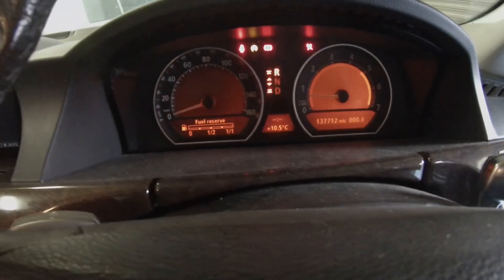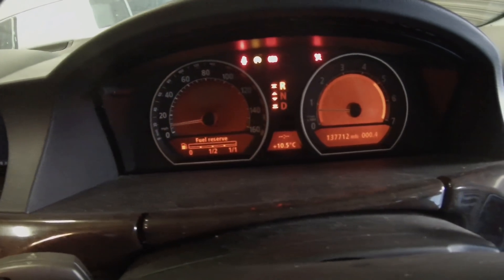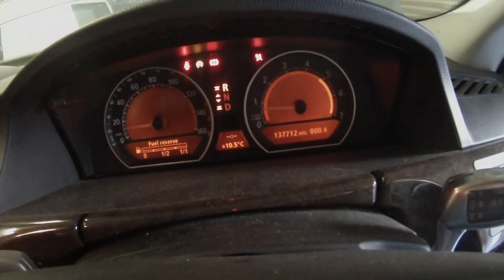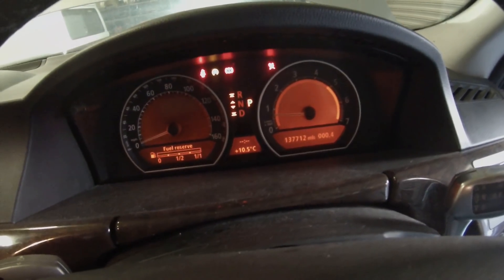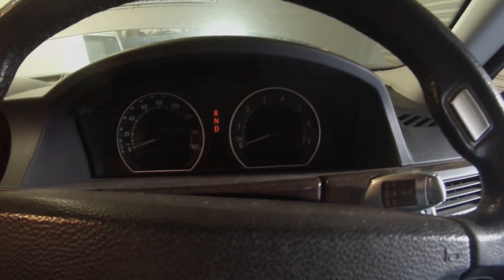Reverse works as well, but the tachometer won't work because MG2 speeds report as negative values and I've screwed up my programming. We can go into park and then basically switch off. The next part of the puzzle is to tidy up the wiring on the front a little bit, drop the vehicle down on its wheels, and see if we can just move it forward and back a few feet here within the workshop. It'll be the next day that we'll have cooling on and can actually go driving.